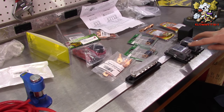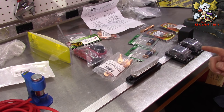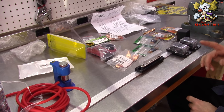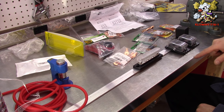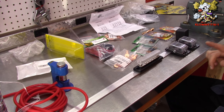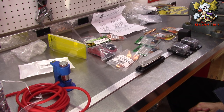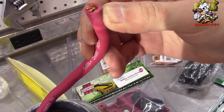For the power feed from the battery, you can do a Google search for a 12 volt automotive gauge chart. You'll need the amount of feet you're going from the battery to the fuse blocks, and the amount of amperage going through that wire to get the correct gauge. In this case we looked at the chart and it's about 2 gauge wire — it'll handle 200 amps, which is the combination of these two fuse blocks. We got 2 gauge welding cable, so we're using this.